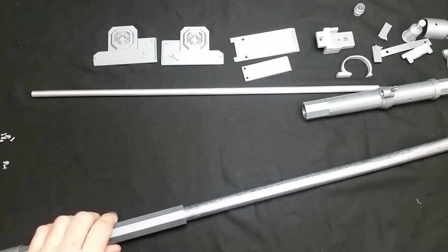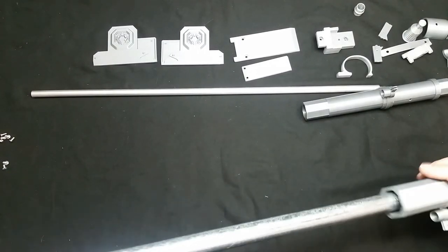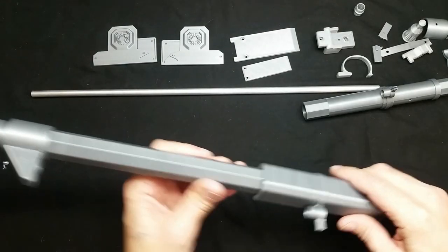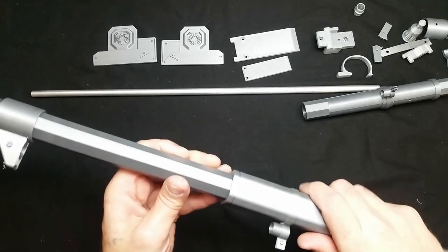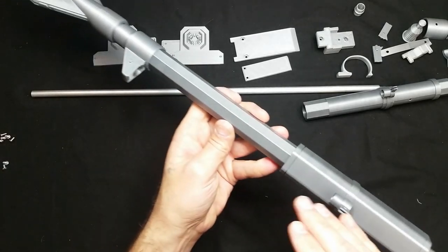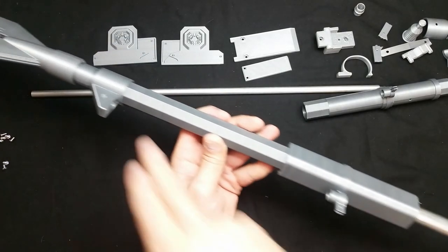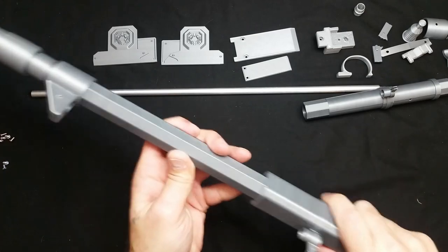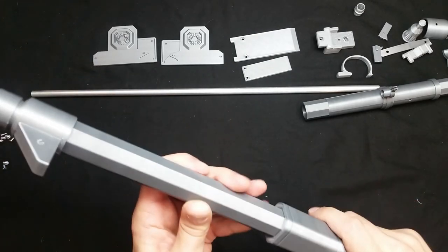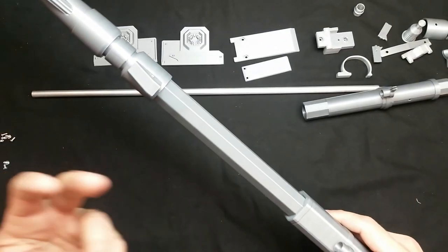Yep, all dry, all good. All right. And I put all these to where they go together perfectly straight. Now, you can clock them wrong, you know, that's not in line with that. So, all you have to pay attention to is that your clocking is in line and that your grommets face the fork.